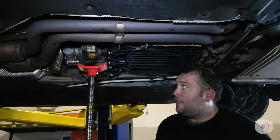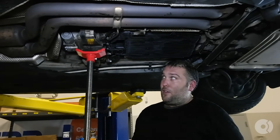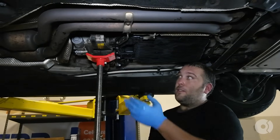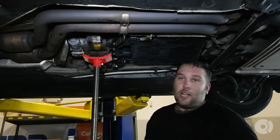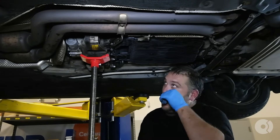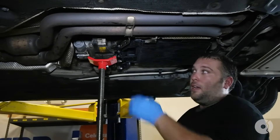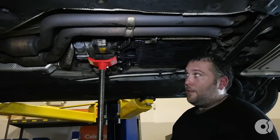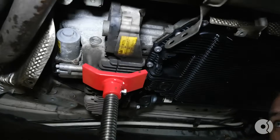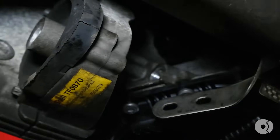The only other thing I would recommend is quickly checking the fill plug — it's already been torqued to spec, so there's really no reason to check it, but you never know. It could have come loose or somebody else could have removed it at some point, so it doesn't hurt to double check before you start filling the transmission up. Right now we have this thing torqued back up. I'm going to do the initial fill with the bracket off, but once we do the initial fill I'm going to put the bracket back on, and we'll do the final fill by the book.